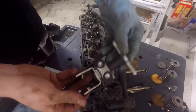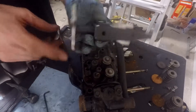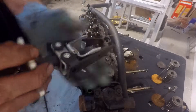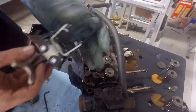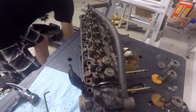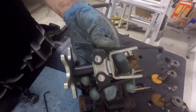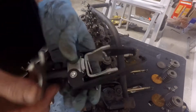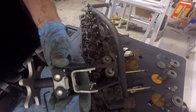There is a science to this. I already got the first few, so I have some tips and tricks. Number one: after about the first two of these, because this puts so much pressure on the tool — on the little corkscrew in it — what I went ahead and did was use some gear oil to oil up the threads on the screw. It went a lot better after that. The whole sliding is a lot smoother after you oil that up. You don't have to use gear oil; any kind of oil will do the trick. But that is something you're probably going to want to do.